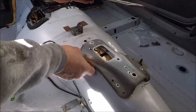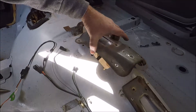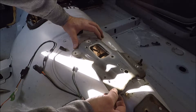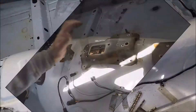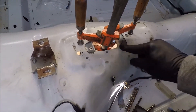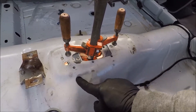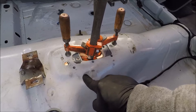Now I've got to try to put this back where it's going to line up. I'm pretty sure it's going to end up right about here. I've pushed the 98 bracket up underneath and used some clamps to hold it up in place where it needs to go. This little notch right here worked out perfect — it is exactly where the third bolt is for the emergency brake, so that gives me a place to line it up so I know I'm lined up correctly.